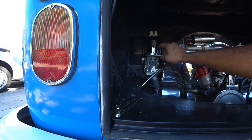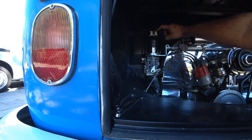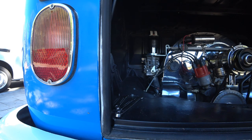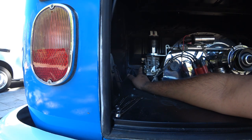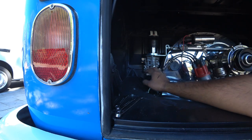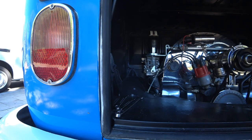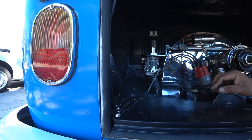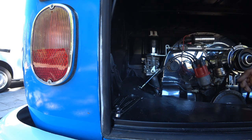Now that we have the syncing tool here, we're going to adjust the throttle when the car is on. This will set your RPMs — I want to set it around 500 to 600, sometimes 450, it just depends on how fast it idles. Once you figure that out, the next thing is balancing your cylinders. Since you have dual carbs per side, technically you have 4 carburetors — one throat per cylinder. So you have 4 adjustment screws: one here and one towards the back. These screws let you set your balance and harmony across all 4 cylinders, and that's something you have to listen for.